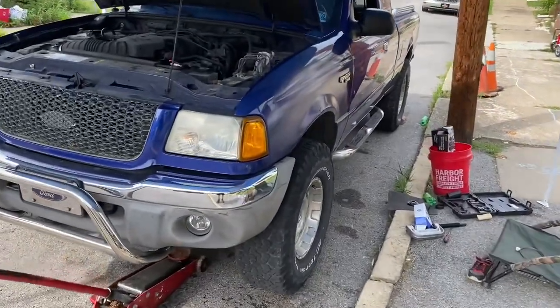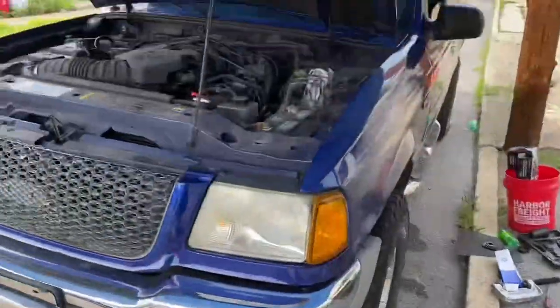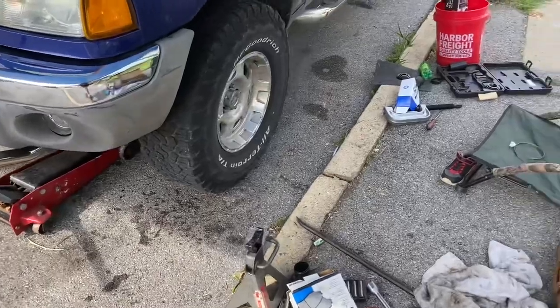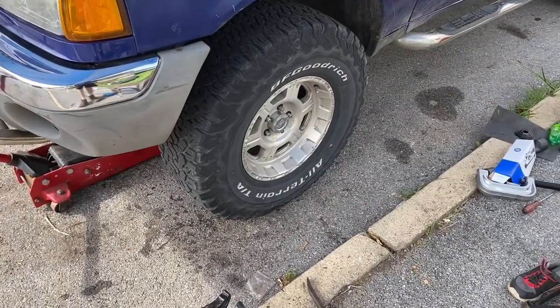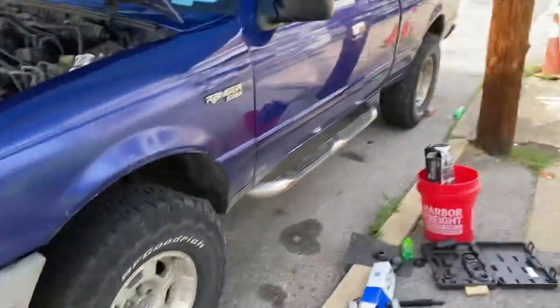It's the best way to keep out of the sun. Looks like I'm gonna have to adjust it — the sunlight's starting to creep up on me. The truck's getting worked on: doing lower ball joints, upper control arms, tie rod ends, and brakes and end links on the front end. After that's done I gotta go to the rear.